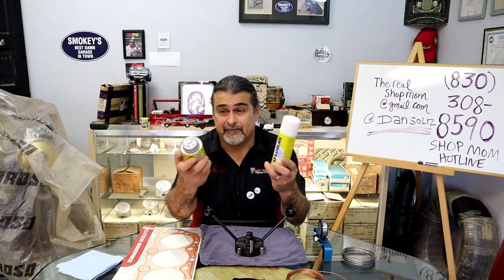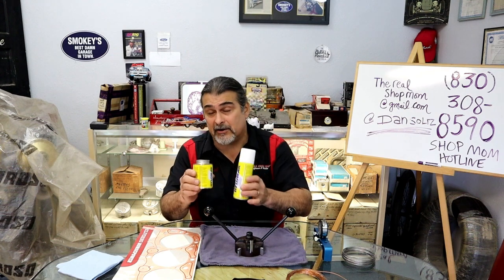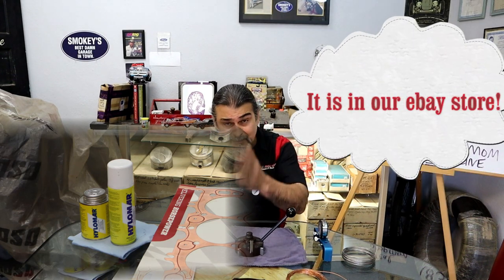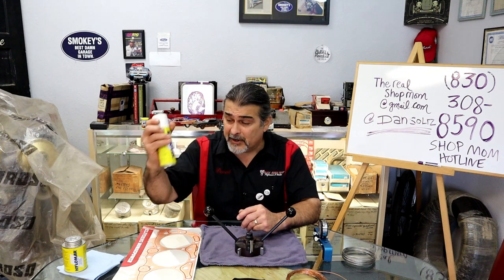All right, what else? We're talking about sealing the gasket. This is what I use, Hylomar. I use Hylomar in boosted applications, and we're not having any coolant leaks at all. Hylomar is what I recommend. If you can find Hylomar, we are doing an eBay store, and I'm going to start putting all the stuff that I have links to in our eBay store. Right now we don't. Contact Shop Mom, Elaine, and ask her that you want some Hylomar. You can get it at Grainger, but it's quite expensive at Grainger, and it's probably cheaper if you get it from Shop Mom, but all that being said, this is what I use.